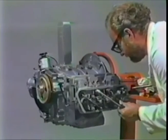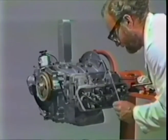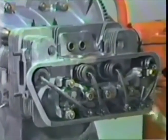You can screw it down to where the screw gets tight and there's no gap, and back it back about 1/8 of a turn actually. Wiggle it. You can feel that's too tight. Back it a little bit more. That's just about right. You can actually see about 6/1000ths. We'll check these with the feeler gauge, of course, to make certain. But if you've done this enough times, you can get the feel of what a 6/1000th gap should be like. And just to show you how close I can come, I'll first adjust it by hand and then use the feeler gauge on it and check it that way. All right, intake valve the same way.